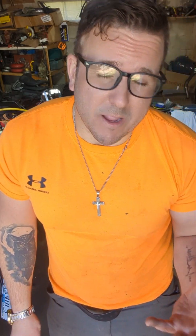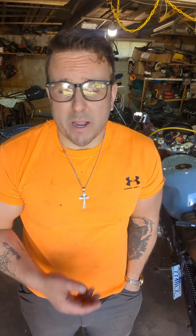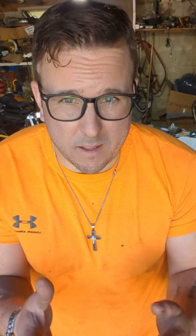I hope you've got something out of this video. If you have any questions, comments, or concerns, or if you've seen or heard something I didn't — because I don't know as much about diesels as I do gasoline engines; they're still new to me — any information you can give me I greatly appreciate. Remember: one sixteenth to one eighth of an inch, a couple millimeters at a time, advance or retard. Be very careful with that and take it for a drive every time. If you're DIY like me, get yourself an infrared thermometer and check your manifolds. Thank you for watching, subscribing, and liking. Until next time — be impeccable with your word, don't do anything stupid, do your best, don't take anything personal. See you on the next one.